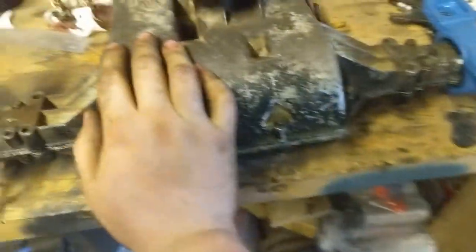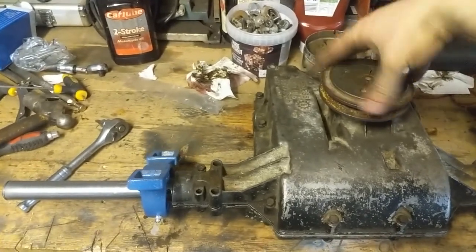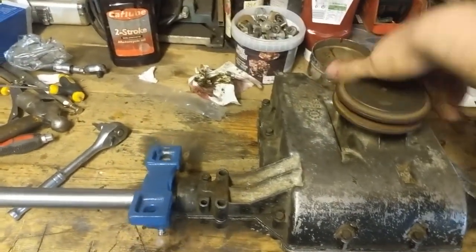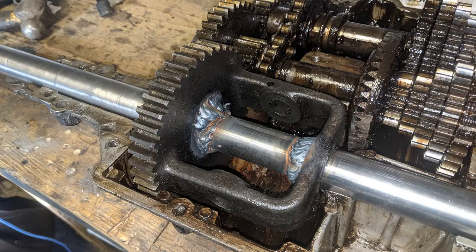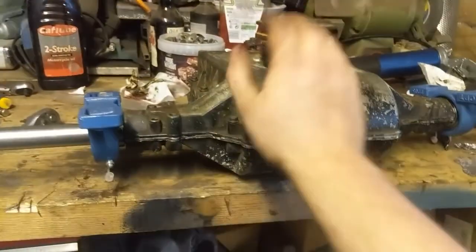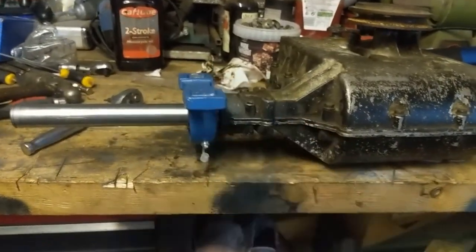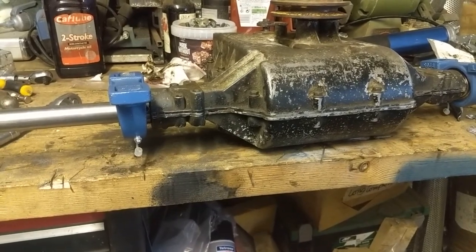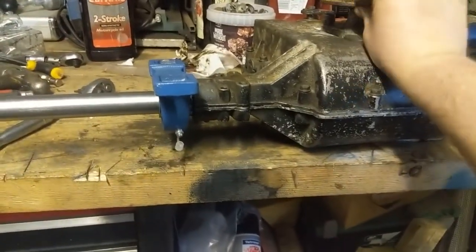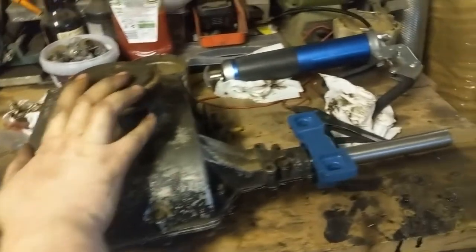It's all built up now. This is the final design - hopefully it'll hold itself together. You can see when I spin this it spins the other way, so that's all driving now. That is a solid shaft - there's no diff, it's a solid axle straight through. The plan is to use these bearings to help carry the weight of whatever's on the back of the mower, so none of the weight goes onto the actual axle and the aluminium casing shouldn't have as much stress - all the stress hopefully gets put onto these bearings.